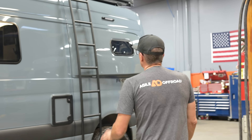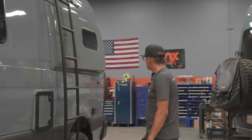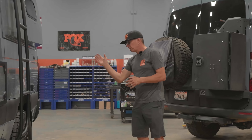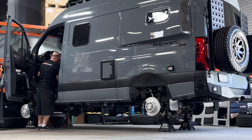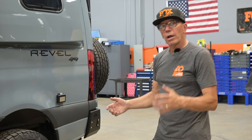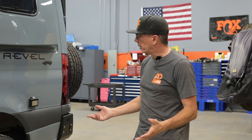Luminous Lab — this one has their new finish on it, which is pretty nice, a different matte finish. In the rear you're seeing the big brakes. This has our full rip kit — a replacement rear spring so we eliminate the block in the rear and get rid of the high-heeled geometry that comes with it. That makes it handle far, far better — not just because we changed the spring, but because we actually removed the block from underneath it.